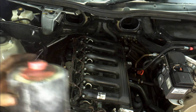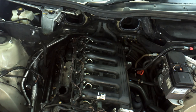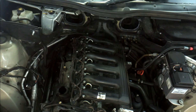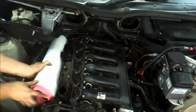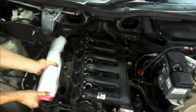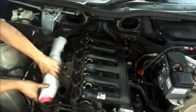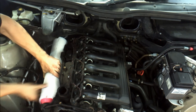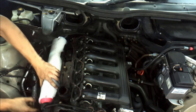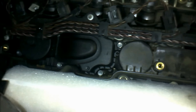That's the air filter out. It's got a little rubber lug that goes on the bottom at the back. Before I put the air filter in, I usually just blow out the leaves and junk, then pop the new filter in. You can see on the side closest to my right hand, that's a little pink O-ring — you've got to sort of work that a little bit. It tends to want to fold up towards the bottom and not seal properly, so make sure you've got that on properly. Don't use any silicone or anything like that — it'll bugger up the airflow meter. Just keep working it and pushing it on.